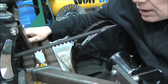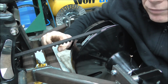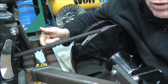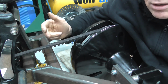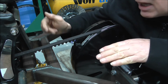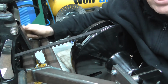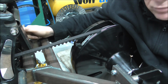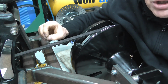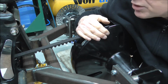So yeah, a few things to consider when you're doing brake lines: 1, put it together properly. 2, radiuses, you don't want them too tight so it kinks the pipe. 3, making sure that it's not against something where, if it's a moving part like that bit of pipe there with the swing arm moving up and down, the pipe can move. So make sure it's not actually against anything that can rub and cause it to wear through. And nip points, make sure it can't be squashed in something, which, the way it's done now, I've cleared all those points.